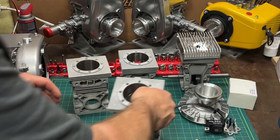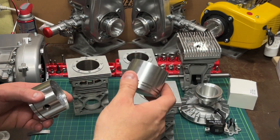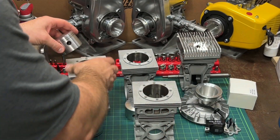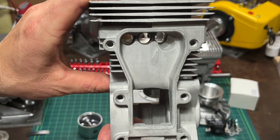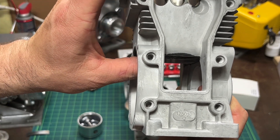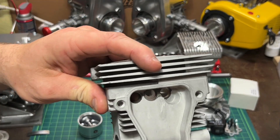Looking at the piston, you can see a couple of differences. Aside from the one versus two rings — we have single-ring standard bore pistons — one of the things you'll see is the piston has been taken down right here. That modification was made because if you put a standard 820 piston and it comes down lower with a stroker crank, the connecting rod would come around and hit the skirt of the piston.